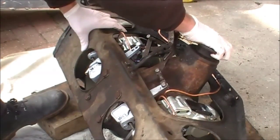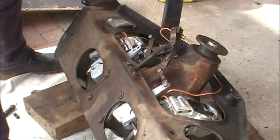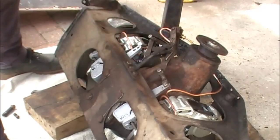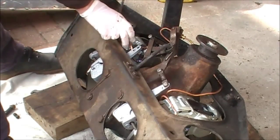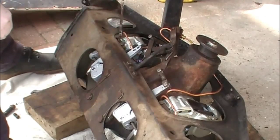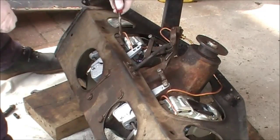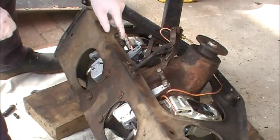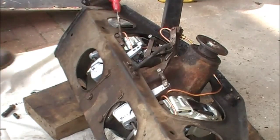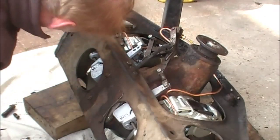Right, for this job you want to see in the front side. What you have to do is lift that spring, those prongs, that fork up about 20 millimeters. So there we are, look, I've lifted it up underneath the heads of those bolts. So now it's raised up, you find you can get the legs, the prongs of that spring into the holes.